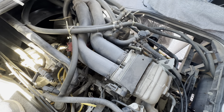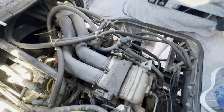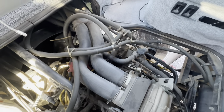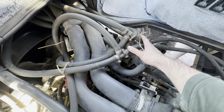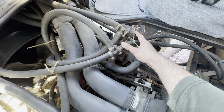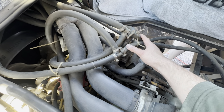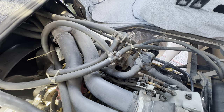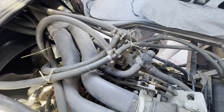This is the engine — this is a Ford 7.5 460. One thing I did last time I did this was right here where the heater hoses go to the back auxiliary heater, so when the engine's running you can run heat into the back. Just to make sure we're all cleaned out, I like to pull both of them off and drain those out as well, so that we make sure we've got as much antifreeze out of the system as we can. Then we will refill it, and that is the extent of the flush.